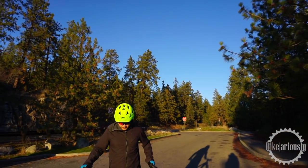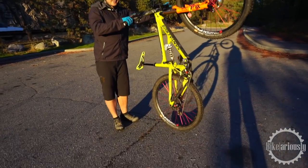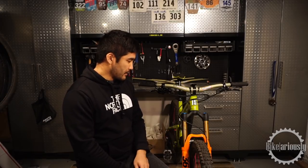Now for the long-term review: I've had this bike for just over a year. In terms of quality, it really doesn't get much better. What I love about Santa Cruz bikes is the ease of maintenance — they use threaded bottom bracket cups, making it easy to diagnose and address creaks. Probably the most annoying part is cleaning the VPP linkage, because everything is so tucked in there. I had to clean it once and while the bearings were fine, it was quite gunky. If you spray some water in there after a muddy ride, it stays fairly clean.